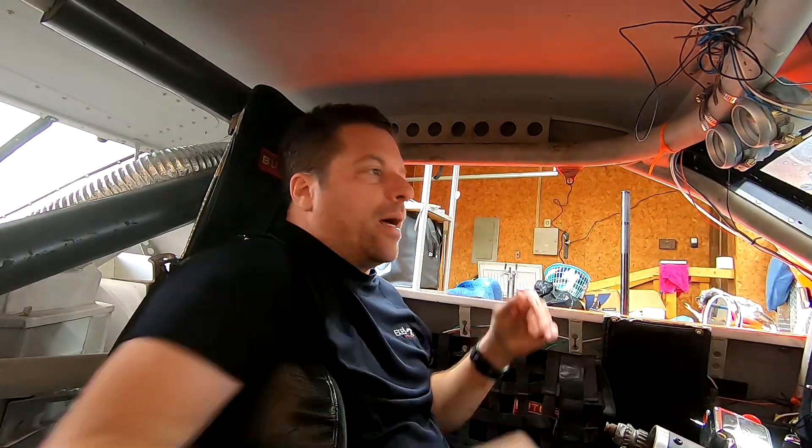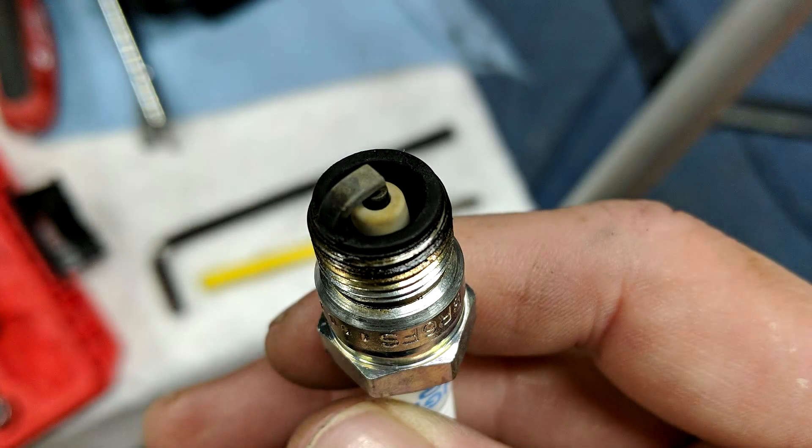I put the heaviest springs in there — the natural ones, those are 8-pound springs. I'm hoping those are going to be able to hold the vacuum back so I don't have that problem with it going super lean when I get on the throttle. If that doesn't work, I'm going to have to figure out some way to buy springs that are even stiffer than these, or maybe figure out a way to shim them. I'm almost positive that those springs are not allowing the metering rods to go into the rich mode soon enough, and it's starving the engine for fuel right off idle and right off cruise. Now that I've got the stiffest springs in, we're going to take it for another drive. If that hasn't fixed my problem, I'll go richer on the primary and see if I can make up the difference that way.